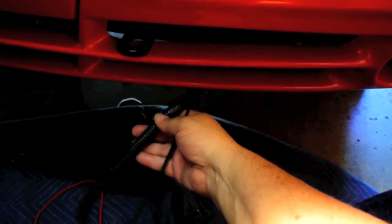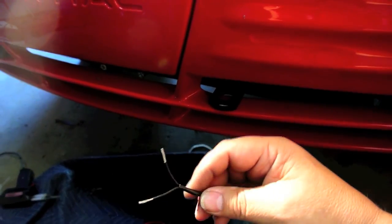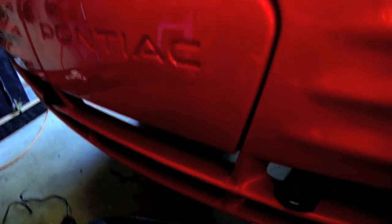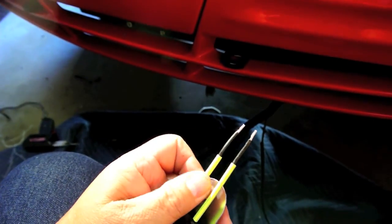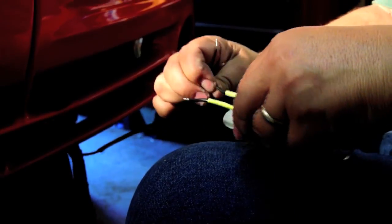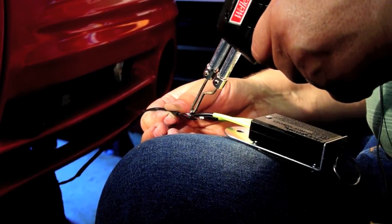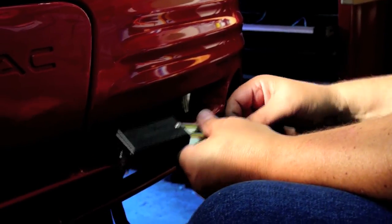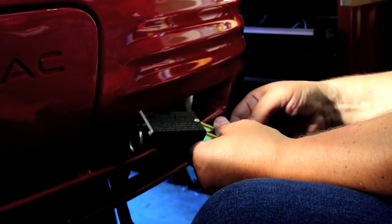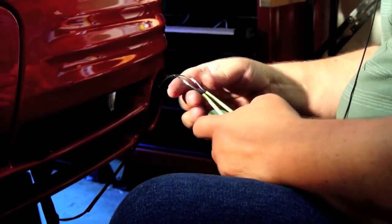I fed the breakaway wire through to the bottom of the car, put a piece of heat shrink here, and stripped the two wires. Likewise on the breakaway switch I've stripped the two wires and have heat shrink ready. It's going to be hard to make a good mechanical contact, so I'm going to put some solder on here and heat this up. Now that should be good enough — we've got pretty good contact and it's fairly bright. If you get these things where they're dull, that's typically referred to as a cold solder joint. You want them bright.